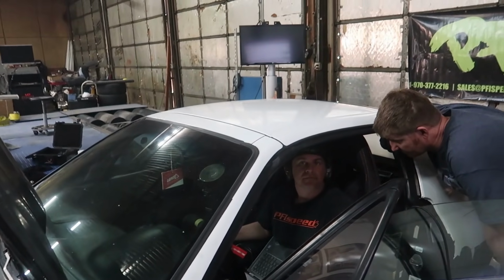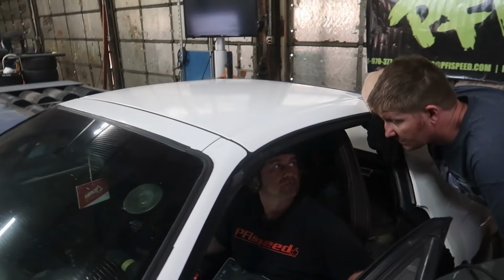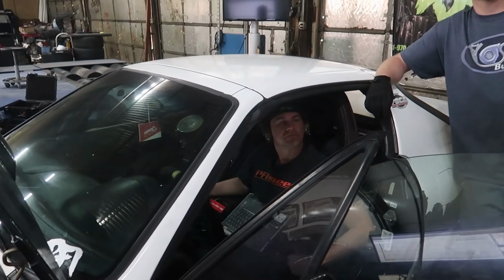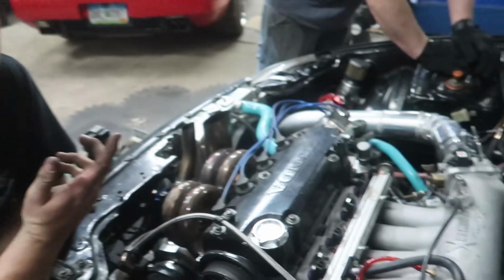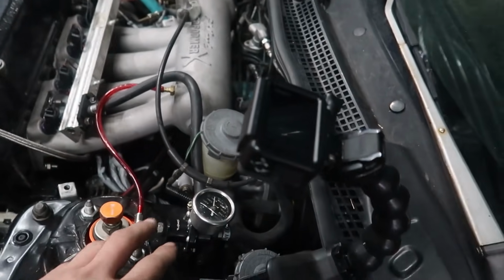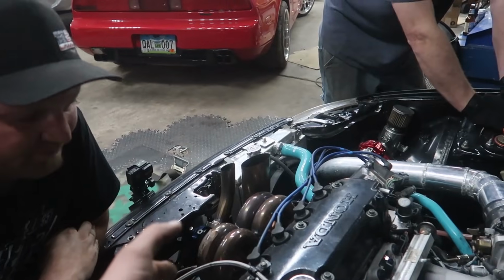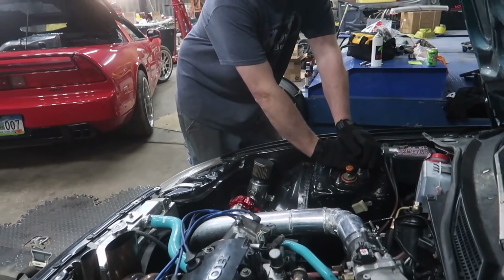It says there if I see thousands, but it's got a 450. And he said it rose. Damn. Yeah, the fuel pressure. We'll double check this camera, but from where I was standing, it rose, and it probably went up to 80, which the math adds up. It goes up to like 70. But it isn't one-to-one-ing. So it could be this regulator, you know. We almost need something to test because our base was at 58 PSI. We went to 25 pounds. So you have to add 25 pounds to 58. And that should be 84-ish, 85-ish, whatever, in that range.